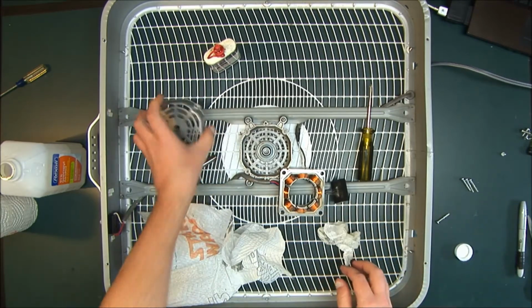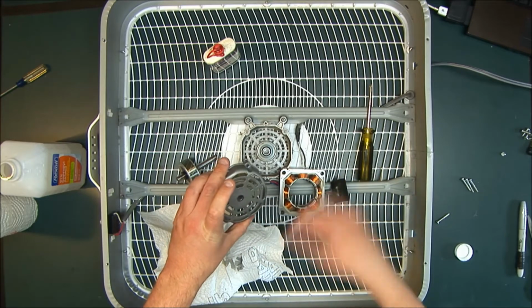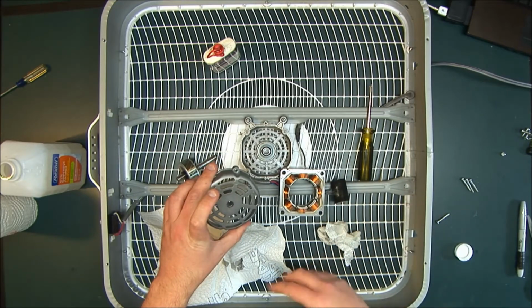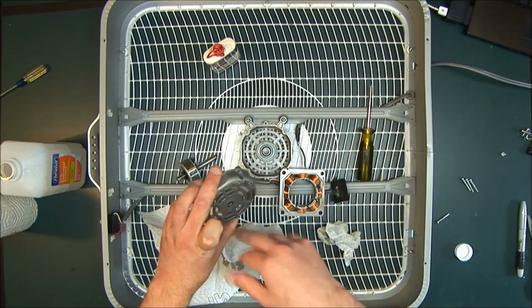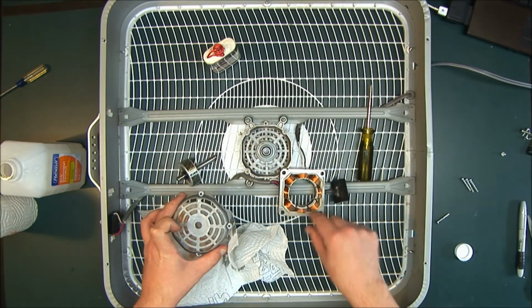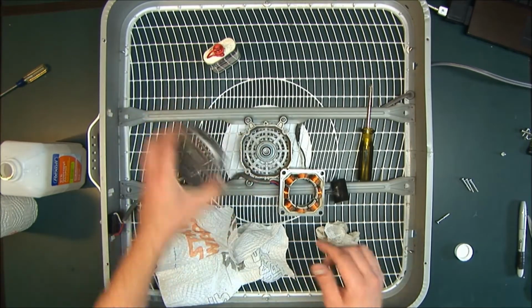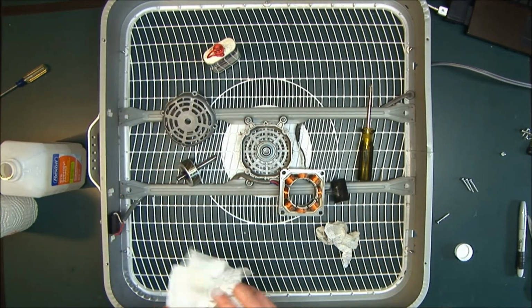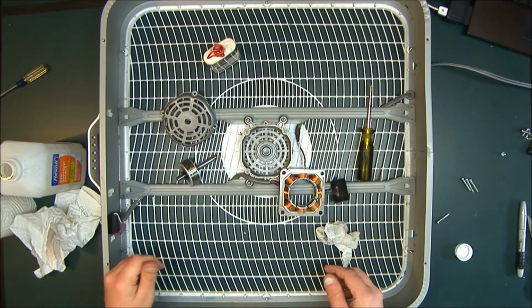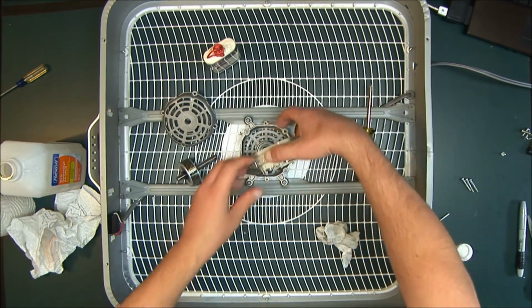And obviously, before you do any of this, and I should have mentioned this before, take some compressed air or an air compressor, whatever you have, vacuum cleaner, blow out all the dust that is going to be in these grills. Also in here, within these coils, get it all clean before you clean the bearings out, because then you're going to be doing the work twice. All right. So now we start putting it back together.